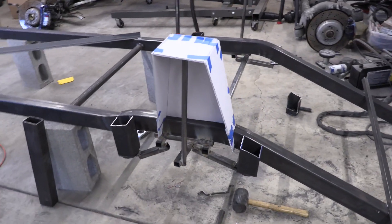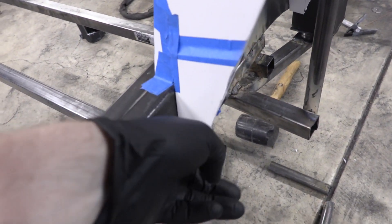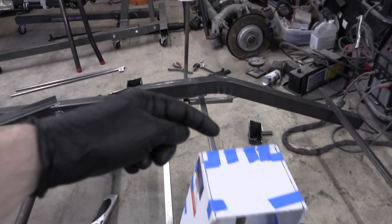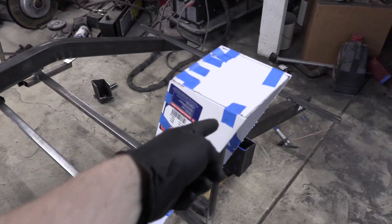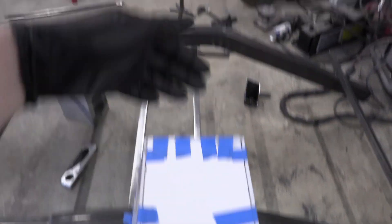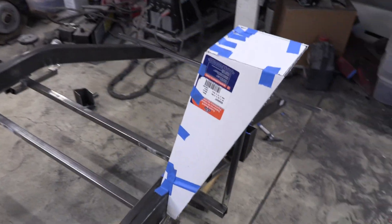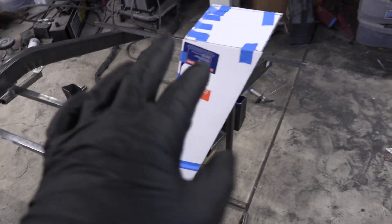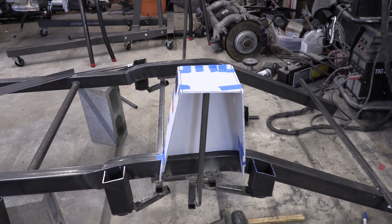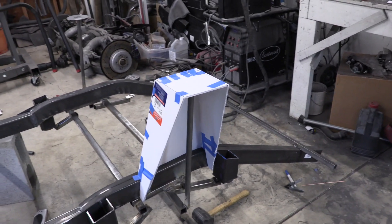That's the design of our strut towers. You can see how it kind of sinks in over here - this will give us a lot more room to weld into the frame, a lot stronger bond. Once we have this, we can do strut tower connectors from one to the other, and more supports from that corner down once we get the body on and verify it's not gonna get in the way. I've measured across to make sure the body will fit - it'll fit just fine. We can reinforce it more as we see fit. This is a rear strut tower, so it doesn't really take as much weight and punishment as the front strut tower does.